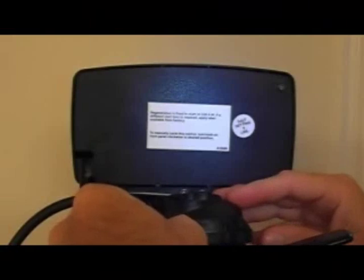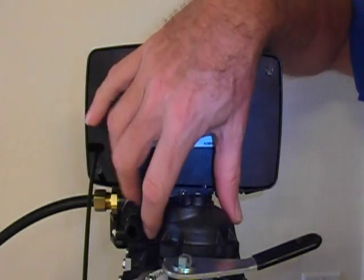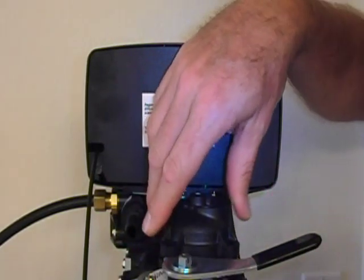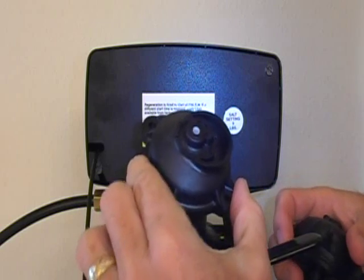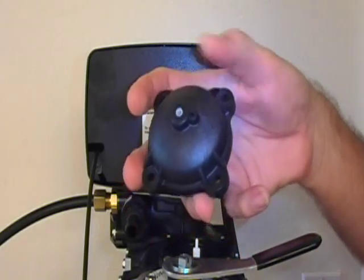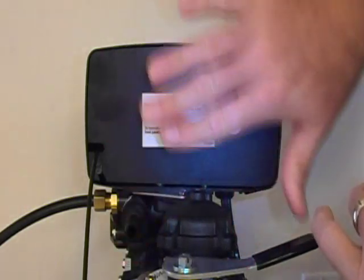When you're putting it on, just make sure you put it on the same way you took it off. The little dimpled end needs to point towards the outflow side — not towards the drain. The white gear ends up being in the furthest back position, closest to the head. This is the newest version; the older ones you'll probably find on your unit have a very small dimple, but that dimple is also going to be on the outflow side, with the white gear closest to the head.